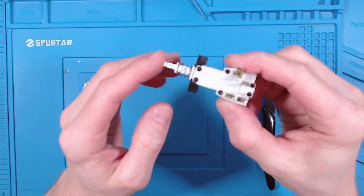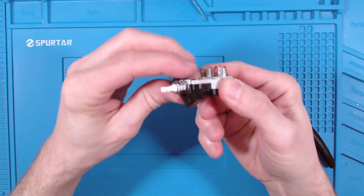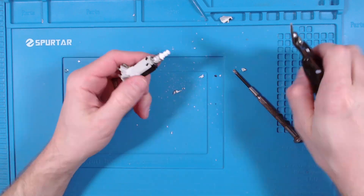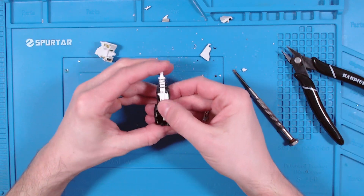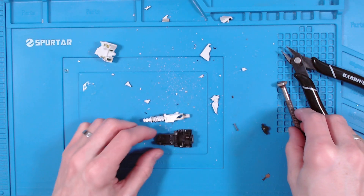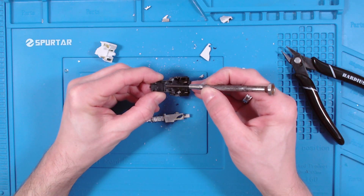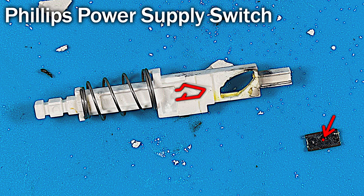So let's have a look at that old switch and see what went wrong with it. I'm going to be quite destructive with this as we won't use it again, but let's open it up and find out why the latching mechanism has stopped working. Did you see those bits fly everywhere? Now you can see the main switch arm, but if you look a little bit closer, underneath it there's this little bit of plastic that can slide up and down, and it's supposed to have a little plastic post on it that slides along the grooves here. I guess it's snapped off or worn away.